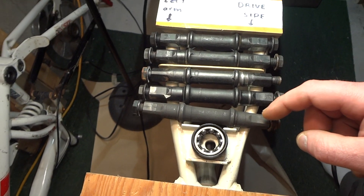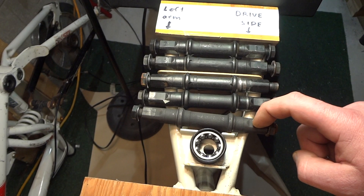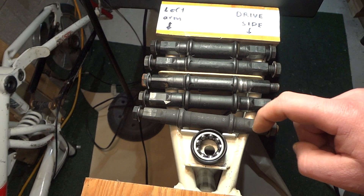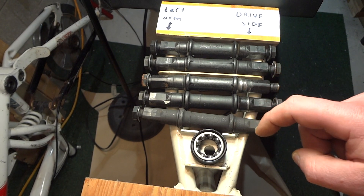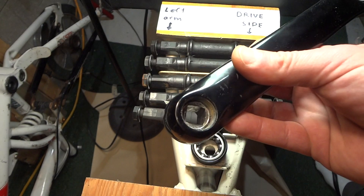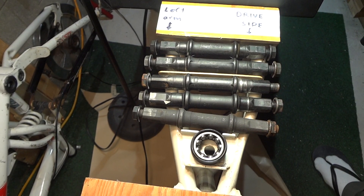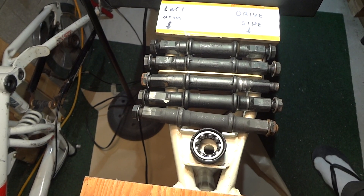It's going to be harder to remove. What I also do is I always grease these tapers — you're not supposed to though, it's not recommended. But if you have, for example, an aluminum alloy arm, I think it's a good idea to lubricate this with a lot of grease. Because those alloy things tend to seize onto this shaft really badly. In the next video, I'm going to show how hard it was to remove from this Iron Horse. Okay guys, thanks for watching, have a nice day.